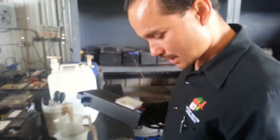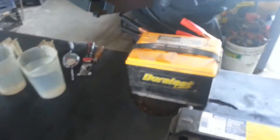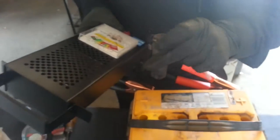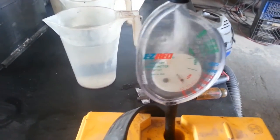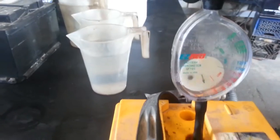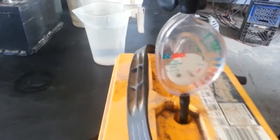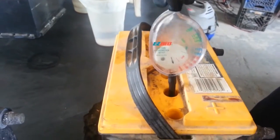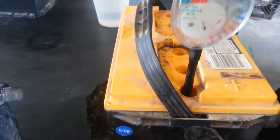While doing this I am going to do a visual inspection of all the cells. Everything appears to be normal — this passes our visual inspection. Now we are going to do a specific gravity test, which is an acid density test. It is going to measure the concentration of acid in the battery water. As you can see it is completely water, which means that all the acid is sulfated on the plates — the acid has crystallized on the battery plates. All cells are measuring water, so this battery indicates a high level of sulfation.